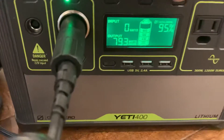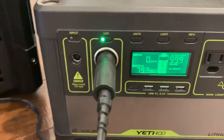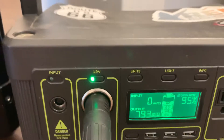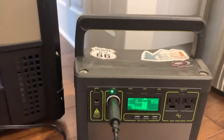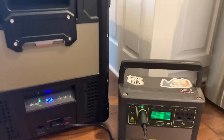It'll sit there and be idle for a while — if you go to the info area here, you'll see it's 99.9 hours, because there's no draw on it right now; the fridge is idle. So I'm really basing it on the percentage of the battery life. When I started there was 99%, now there's 95%. It may have been closer to 100%, but I'm going to say around 5% per 3 hours, so that calculates out to 60 hours of battery.